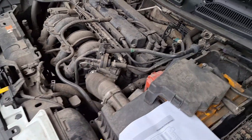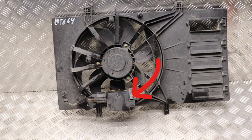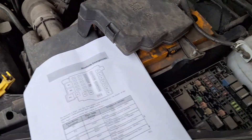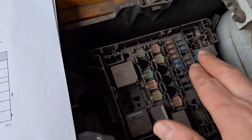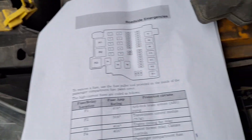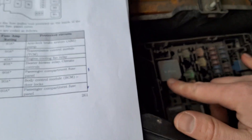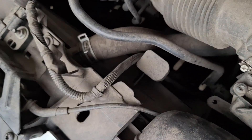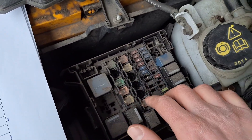There are two kinds of systems in the Ford Fiesta MK7. It may have a special module located in the fan assembly, which is quite hard to access and requires disassembly. The second system works through relays. In my car it has the module, and I can tell because there is no R7 relay. If you have both the R7 relay and the R1 relay, it means you don't have the module.